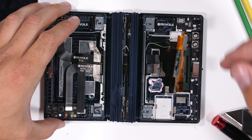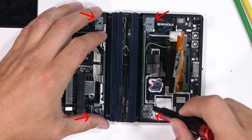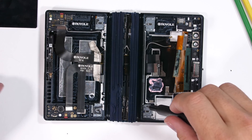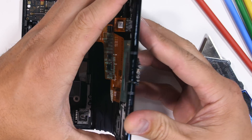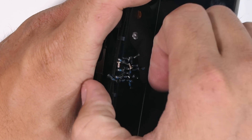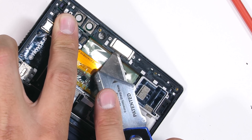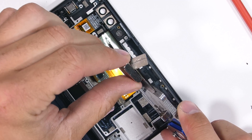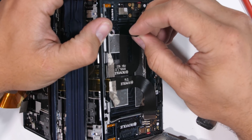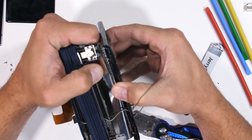Let's take a closer look at the cicada hinge. The hinge itself is fastened to both sides of the phone with four metal brackets, each with four screws holding the little slider mechanism. I can remove all 16 screws along with two more screws along the center of the hinge. There are also two massive magnets on either side of the phone — these help keep the phone in the closed position. The magnet has been secretly collecting all the screws. My razor blade can pry it out of its slot in the phone frame — it's a super big, super strong magnet. I'll pull the long extension ribbons out from the center of the cicada hinge and then wiggle the hinge contraption out from the right half of the phone.